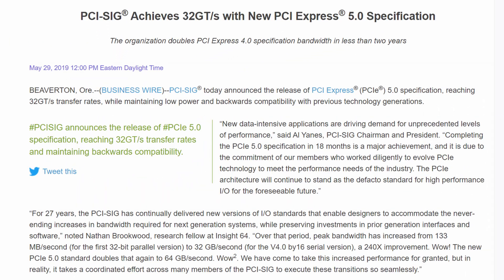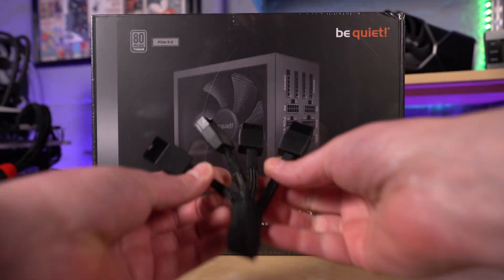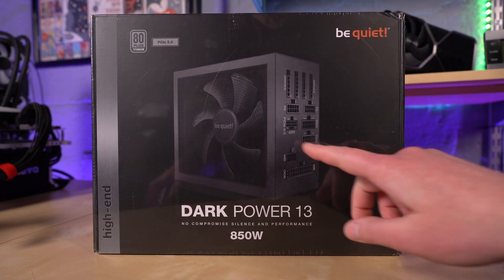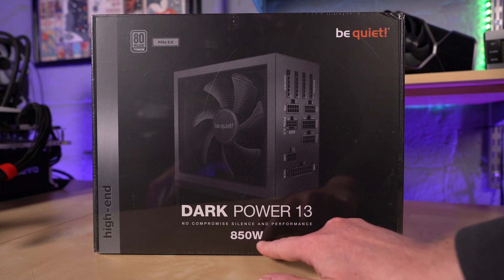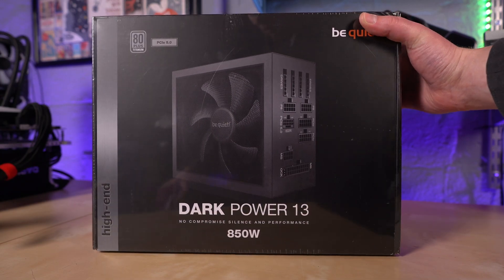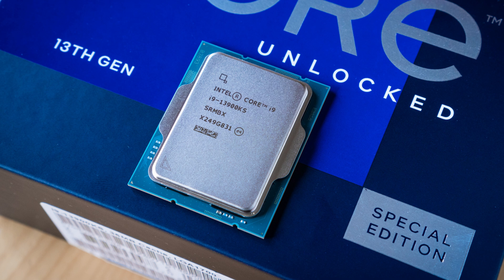You don't need to mess around with one of those adapters — you don't need that. It's built in. Up to 600 watts, so that means it's 4090 ready. Although I'm not sure if you really want to run a 4090 on an 850, it's definitely possible. Just don't pair it with one of those 300-watt CPUs.